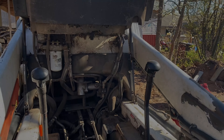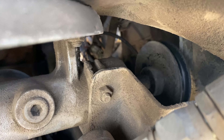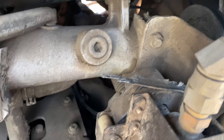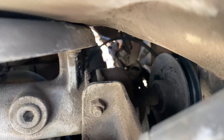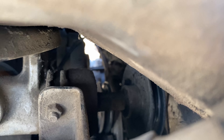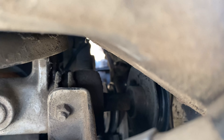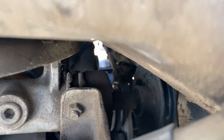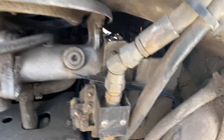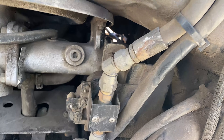So we'll climb up in the machine. Okay, we're up in the machine — there's the pulley we're looking for, and you can see there's the broken belt. There's no belt on the pulley. That pulley goes down to the motor, and there is a tensioner pulley as well — that's a plastic tensioner pulley. Check that plastic tensioner pulley, make sure the bearings are okay on it, make sure it's not cracked or anything like that. This one happens to be okay. So we're going to pull this nasty piece of belt out of here and replace it.